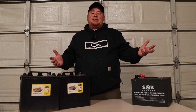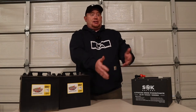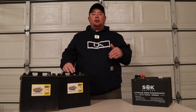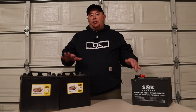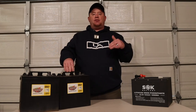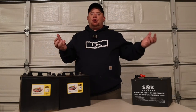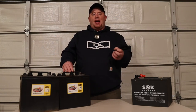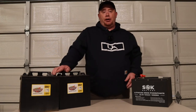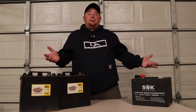You're probably asking at this point — well, that lithium battery is the winner. And not necessarily. I am not going to tell you that lithium is right for everybody. If you're a weekend person in a trailer that doesn't have a lot of needs — you've got some LED lights, you still have a propane fridge, you don't have inverters drawing massive amounts of power — you're probably going to be okay with these GC2s. You're going to get five-plus years out of these batteries and probably be just fine.